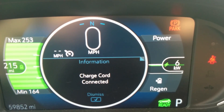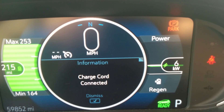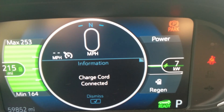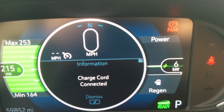You can see the line below the energy marker and the grayed-out regen icon — that indicates that you have less than maximum regenerative braking available. But you'll notice how far down that line is. So at this point you still have a max regen of probably 35 to 40 kilowatts. Without going into any more of the boring details, let's see how this works in real-life driving.